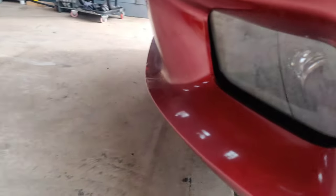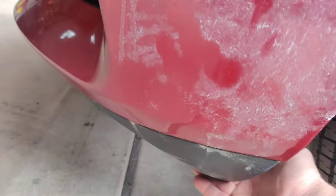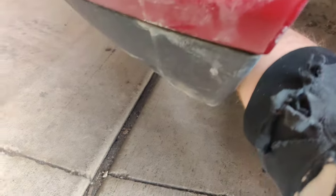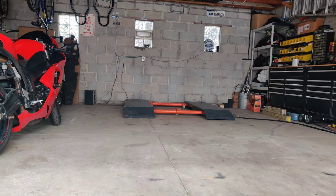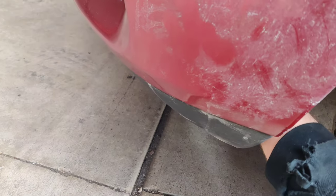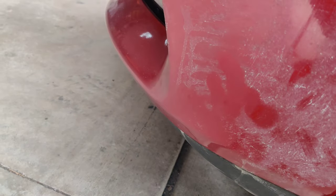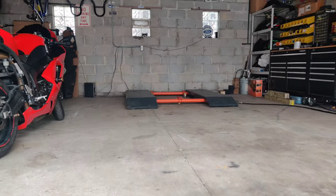You can also adjust from the side of the truck — you don't even have to go underneath. Stick your hand in from the side and adjust the fog light while looking at the wall. Same thing on the other side. I was actually able to spin them with my hand, or just use a screwdriver to see the beam shift.